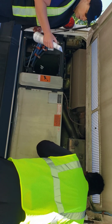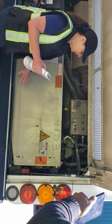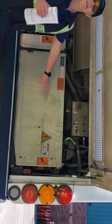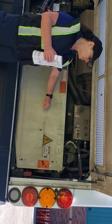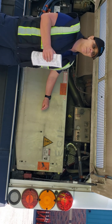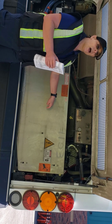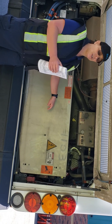We're going to talk about belts. They're located back here — you're not going to be able to see them, but just know they're right here. The belts — talk about condition: they need to be not worn or frayed. You're going to need to talk about how you check the tension of the belt by pushing down in the center. It cannot move more than three-quarters of an inch — that's the deflection.